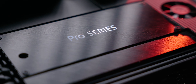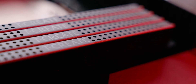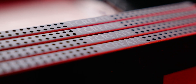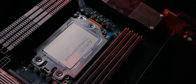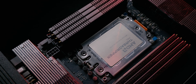Alongside that, I used my standard WD SN850X drive, installed with the latest version of Windows and all the latest chipset drivers. Installed in the motherboard, I had the NVIDIA 5090 by Palit — a GPU I'm very familiar with, that I reviewed previously on this channel. Installed in octo channel, and really the focus of this review, was the T-Create Memory by Team Group. In this kit, I had 128GB of capacity installed over eight sticks, with each stick having an XMP of 6800 MHz. I wanted to test several different frequencies to see if frequency and overclocking the memory would affect my overall benchmark scores.